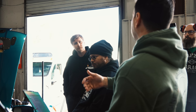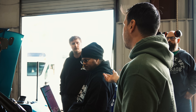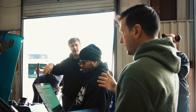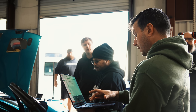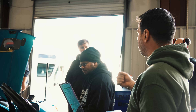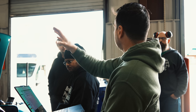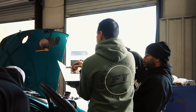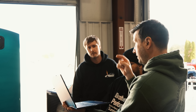Between gear changes, if you do a lot of retard — like negative 30 or negative 40 degrees — it would be stupid retard. Almost all the combustion happening on the exhaust makes turbo speed go up, but we don't know if the suspension or the tire is going to take it. My recommendation would be starting with zero degrees during gear change — that drops timing to zero, which is retarded but not that much. And if you need to drop power after the gear change, you move it to the main ignition table. That's absolute timing — if I put in negative 30, it sees negative 30 degrees, not relative to current timing.